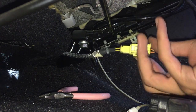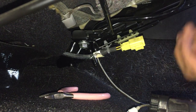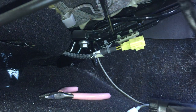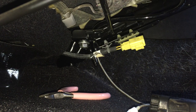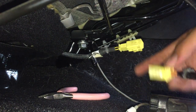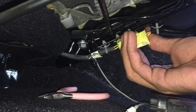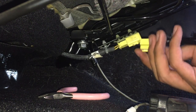All you do is pull on this white part right here and it should disconnect the two pieces of the connector. Look inside the connector, make sure there's nothing odd-looking or loose in there, give the wires a nice good push in. Get some canned air and blow it out just to be double sure. Then put the connector back together and disconnect it, back together and disconnect it — repeat that about five or six times.